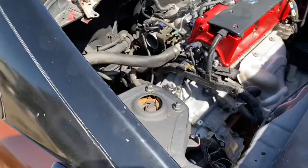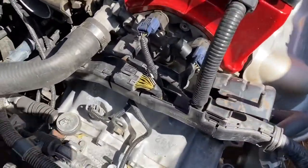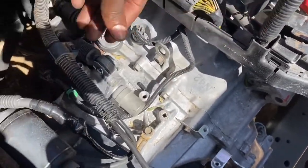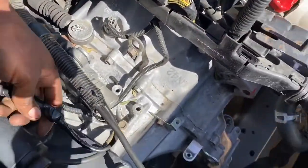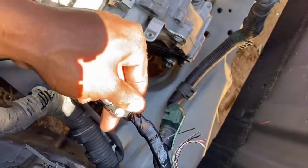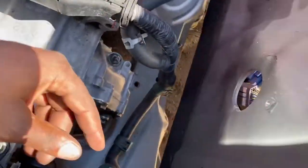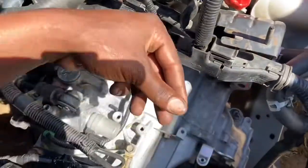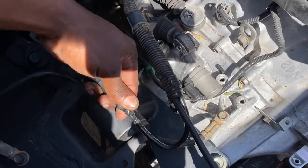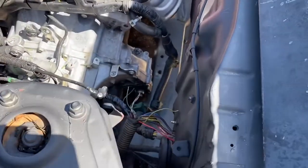Now that the signal is wired, we have to connect a ground to the transmission. We got that on there — just a 12-gauge. The black with yellow stripe is our starter wire and the other black is going to be alternator — I went ahead and connected that for now. Power is connected straight from the battery to the starter, so the starter has a ground, a direct power, and a signal going to a relay. That's all you need to get the starter to work.